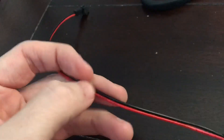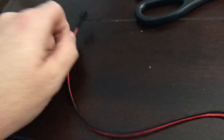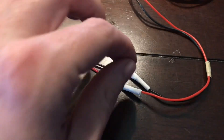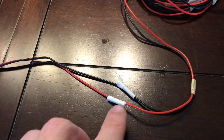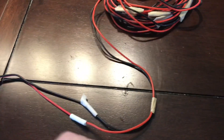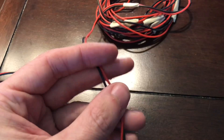You're going to want to cut the power cables, strip both ends, and then lengthen them with the silicone wire so you can use the same plug all the way through to the inverter. Here you can see where I've separated the two wires, stripped both ends of the silicone wire and the existing EL tape wiring, soldered them together, twisted them, and covered them with electrical tape so they're nicely sealed. This gives me very malleable cabling to route through the car.